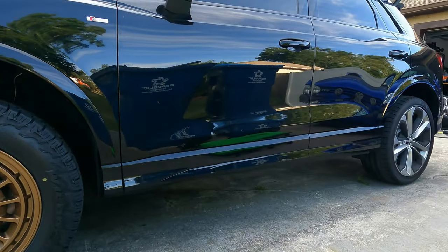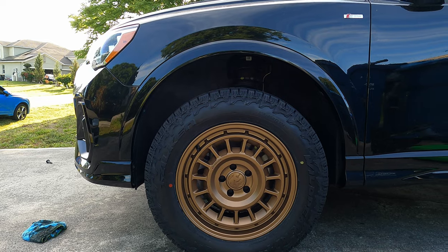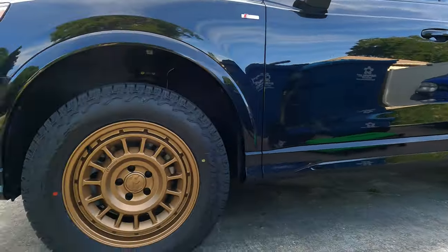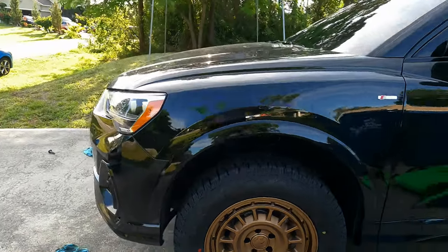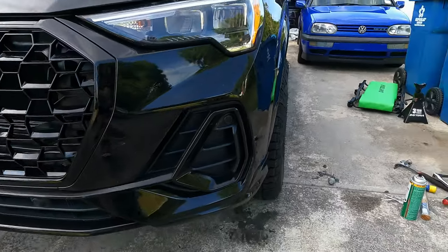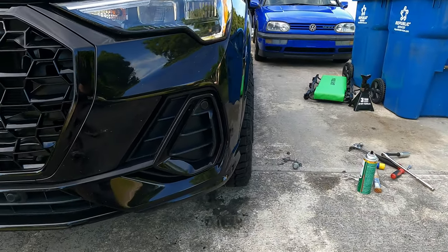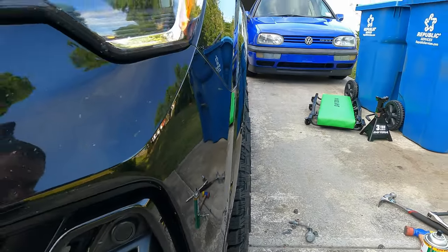We're going to move on to the back. I think the front will come down just slightly once the rear goes on because the rear is going to be raised up just a little bit. This is the fitment with the 15mm spacer — the front is ET5, 17x8 ET5. I think that's looking pretty mint right there.